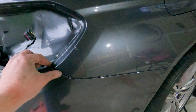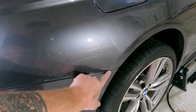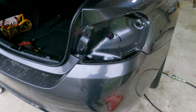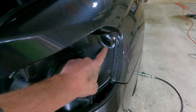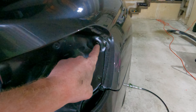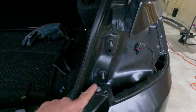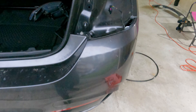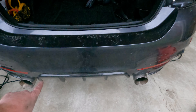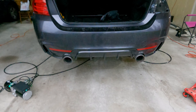Always check as you do this that your body panel is straight, nice and secure, without any huge gaps, because you can interfere with the spacing if this sticks out a little bit. Then all you have to do is walk the three eight millimeters down the side, the three eight millimeters across the bottom, the three 10 millimeters across the middle, and the ones around the other side. Taillight goes back in in reverse order — plug it in, slide it over both posts, push it into place, and put your two 10 millimeter nuts back on. And you're all done.